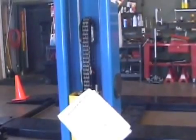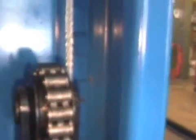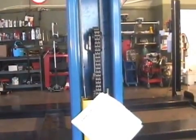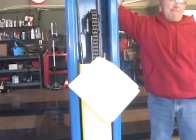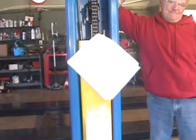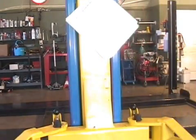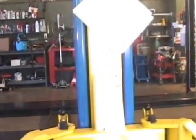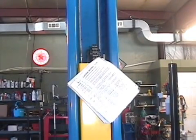As we continue to raise the lift, you'll hear the safety latch catch in — it's in the back of the frame. You can see it back here in the corner, this little ladder. You'll hear it click as the safety engages as you lift the vehicle. Each time that clicks, the safety is getting into position. It will not allow the carriage to fall if the cylinder fails.